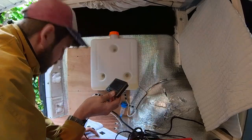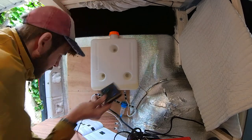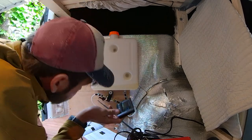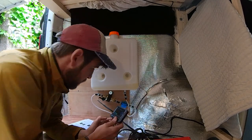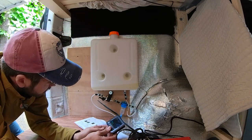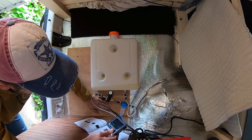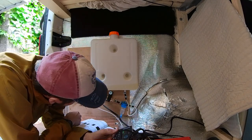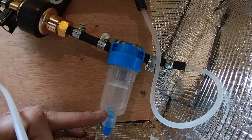Manual pump operation. Press the up and down arrows together. It's coming on. So I think this is to get the fuel pushed around. I hope I've got enough diesel, because I just... oh, there we go. Wow, that's noisy. Yep, it's going through. It should start to fill into the filter, the fuel at the bottom.